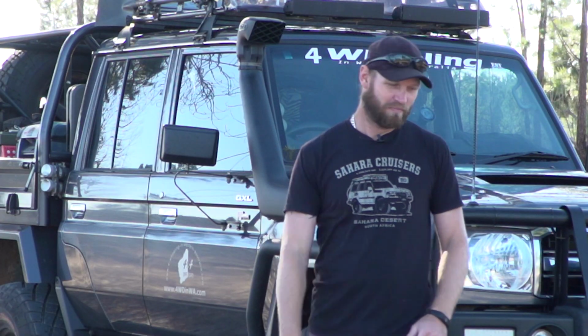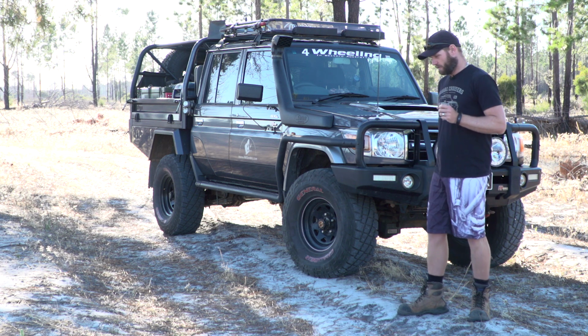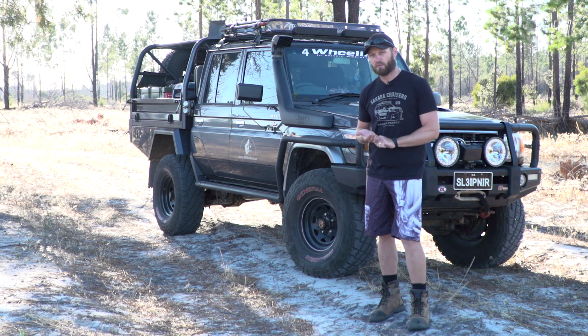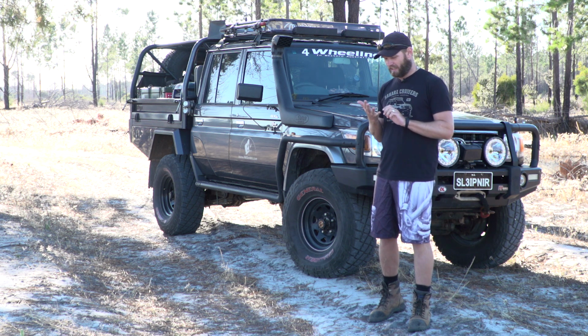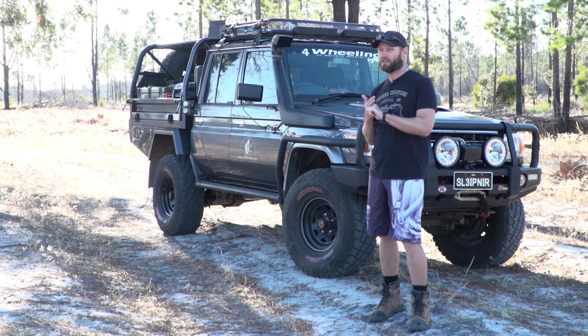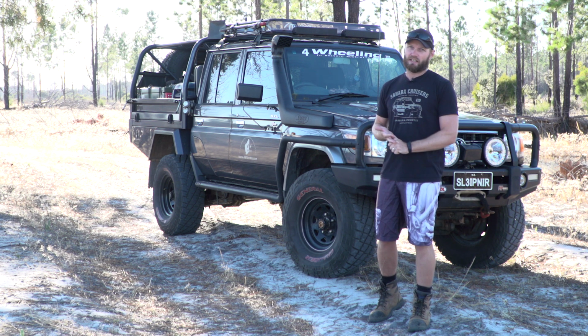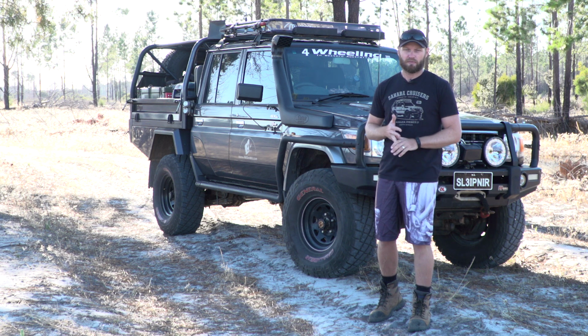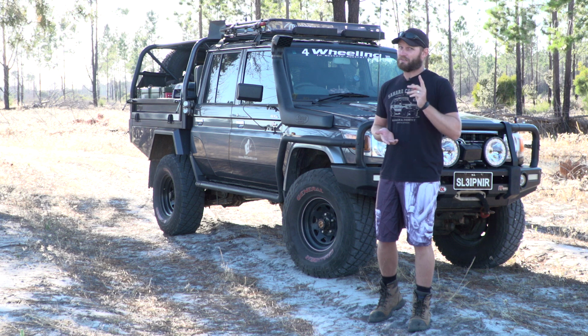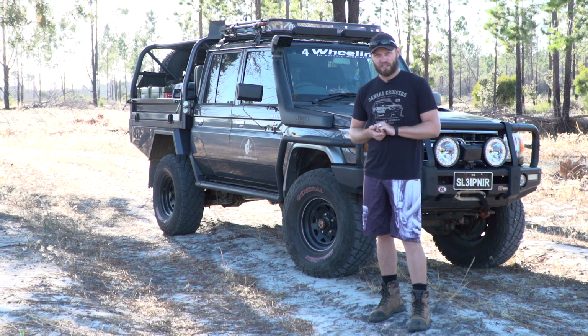So stay tuned. Okay, so first things first, I'm going to talk about why we need to disengage four-wheel drive and what will happen if we don't. And then I'll get on to why we need to re-inflate the tyres and how high you should be going if you're going to hit that highway, even if it's just for 100 k's before you go off-road again, and what can happen to your tyres if you don't. So we'll start with four-wheel drive.